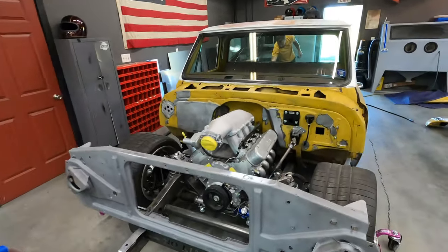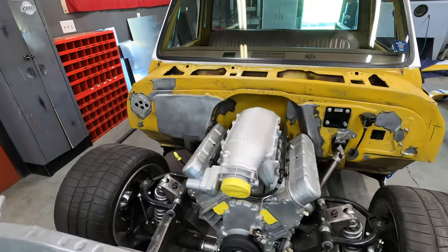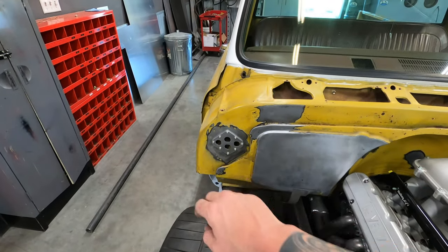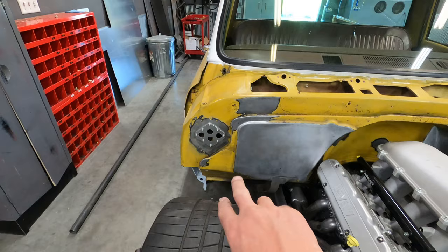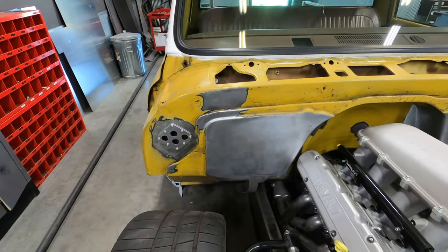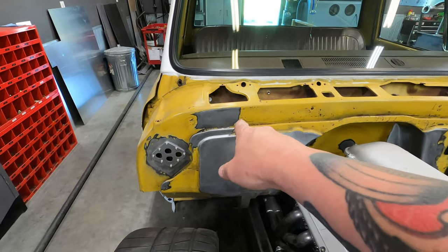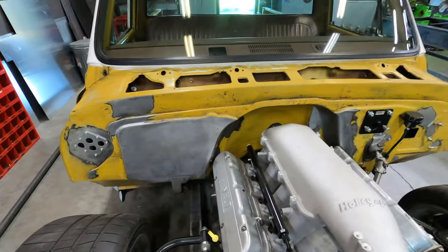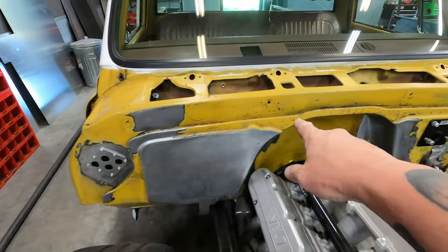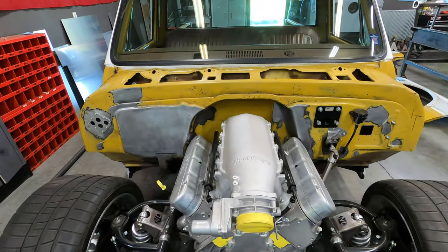That's Old Yeller. We're pretty much wrapped up on all the body stuff so we can go get the patina paint matching done. Running the AC lines through over here — on the inside of the wiper cowl we've got an access port and a cover that we make so the hoses can go all the way through. We wanted to keep this firewall pretty minimalistic, no fancy modifications, just smooth out where the old heater box used to be — there were some holes up here we filled in.